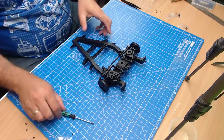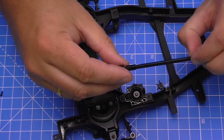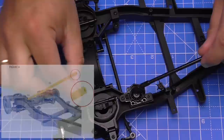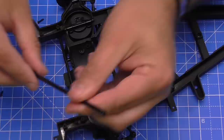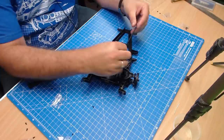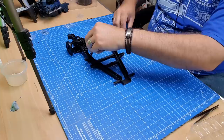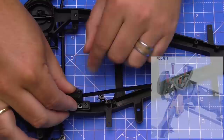Now we're going to add the steering column. Turning it around this way and working on the pinion section - when we put the steering rack on it's going to sit in at an angle. On the end here it's got a semicircular sort of shape, and we need to make sure the flat section is facing down. When I put this in just like that, that flat section is facing down. I'll put the housing cover - which is metal - over the top to keep that lodged in.